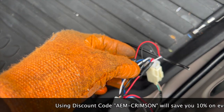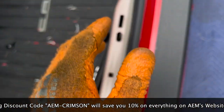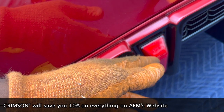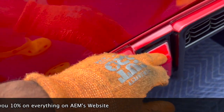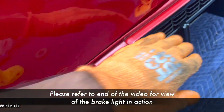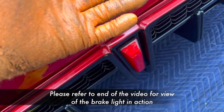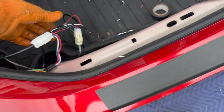The red wire from the brake light goes to the blue wire of the reflector light. I was messing with the white one too — that's why I have electrical tape on that one. After figuring it all out, everything works. The brake light has a running light function — that's the red wire. The white wire is the actual brake light function, and black is ground. The brake light has no strobe function, which is fine — I don't want flashing with my diffuser since I already have reflector lights doing animation every time I brake.